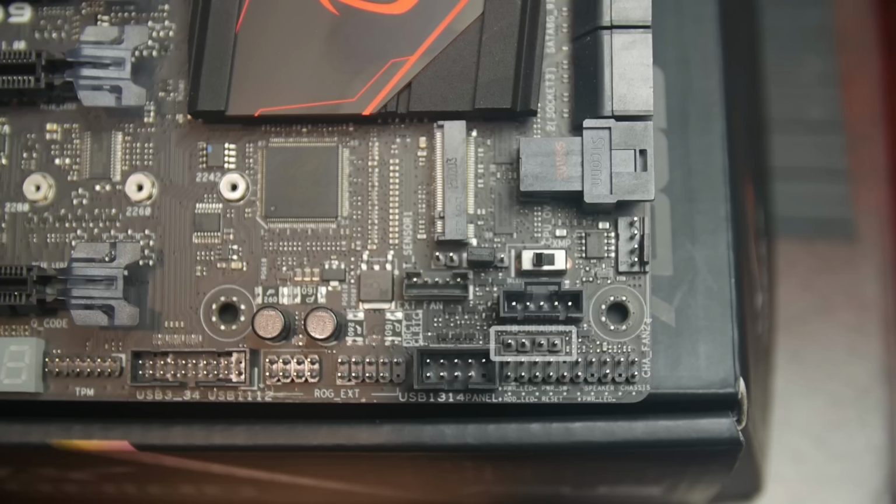It's a button. You can wire in your reset button, for example, on your case, and when you hit reset, rather than resetting the system, it will take you into the UEFI on the next boot. So if your system's off, you can hit that, your system will turn on, you'll boot right into UEFI. Sometimes, especially with quick boot and things like that, you press delete over and over again. Doesn't really work that great because you have to hit delete over and over again, and the computer boots so fast it may not have seen you hit delete. So direct key is just a way to get into the UEFI.